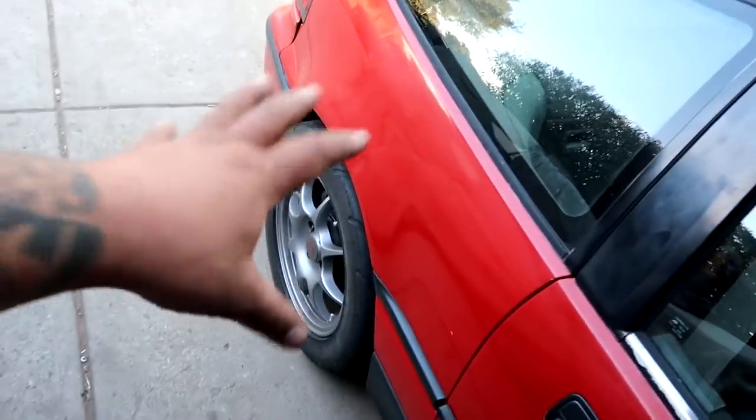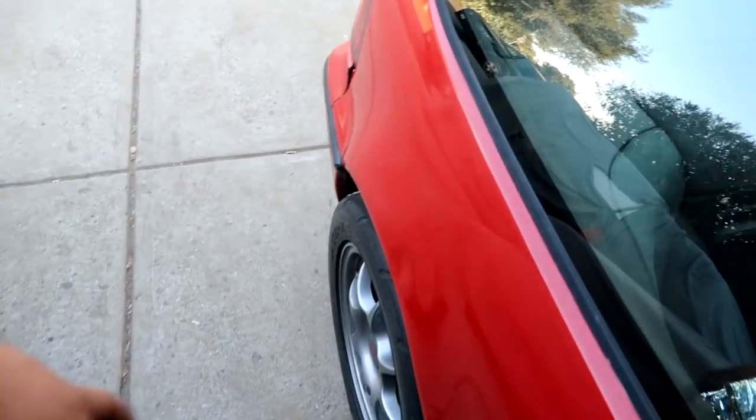But there are a few things that I need to address with the car. One is the boost by gear with all-wheel drive. It's gonna hook up, and I need to up the boost in second gear. If you guys saw the video, second gear kind of fell out of boost, and then it came back in. Third and fourth is 25 pounds, and then it picked back up, which is why it went 110 miles an hour.